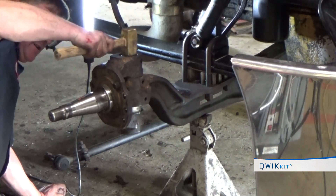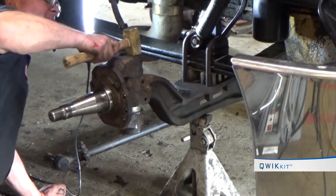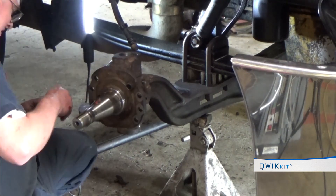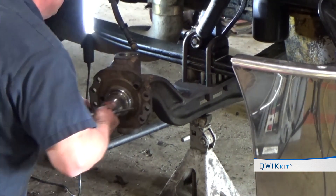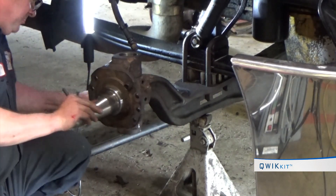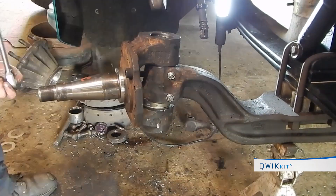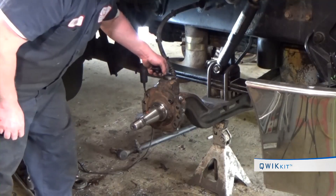With the bearing in place, continue lowering the kingpin until the kingpin lock flats align with the lock pin holes. If needed, only use the handle of a hammer or a brass hammer to help with kingpin installation. Pins should be flush with the top of the spindle, or below the threads in the case of a threaded end plate. Visually align lock flats to lock pin holes, then install lock pins using the sizes, placements, and direction of those removed. Turn the spindle side to side to ensure smooth movement without binding, then use a hammer to set the lock pin into place.